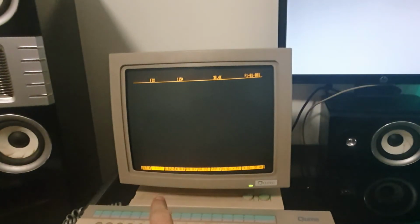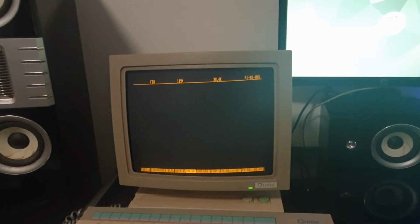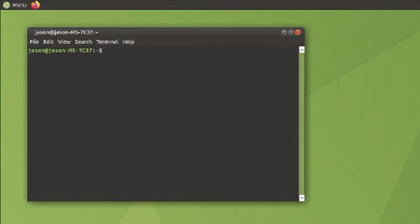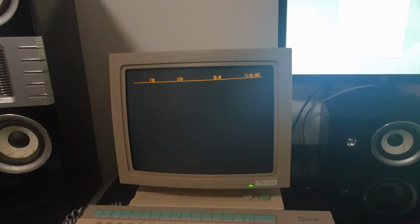And then, once I set those parameters, I just made sure I knew that my transmit and receive frequency was 38400. It'll vary on whatever device you're using. Back on the server, we need to run a few commands to set the speed and the location of the device. So in that first term, just replace dev TTY USB and 38400 with your specific device and speed, and those 3 codes are enough to bring up this login prompt on the client.